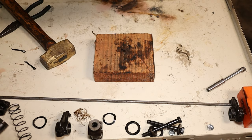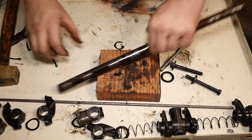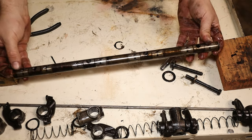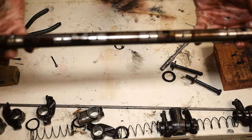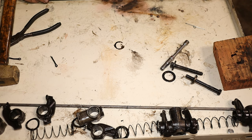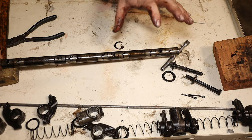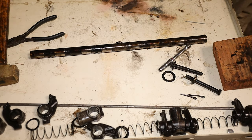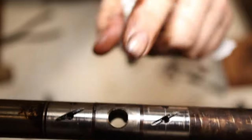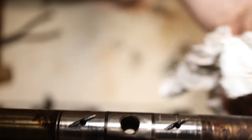I'm really just barely tapping this. Now we've got our rocker shaft cleaned down, and now's the time you want to make sure it is not warped before you continue on. A lot of times these will warp if you tighten them down onto the cylinder head unevenly — it will cause them to bow and warp. So I'm going to roll it on a known flat surface and make sure it's not warped. This one looks pretty good. Normally it will be close to center, or one end is kicked out and it will be enough that you notice it. You can see the bottom of your rocker shafts — the side that goes towards the cylinder head — with the holes and oil grooves cut in there to oil your rocker shafts.